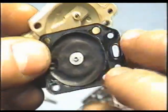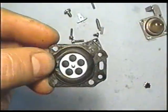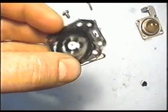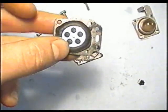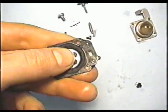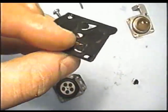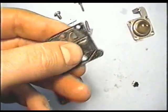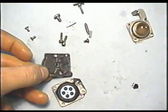You can see there that the gas has varnished a bit. Here's a closer look at the metering diaphragm — when it's in your hands, that's when you really see what kind of shape it's in. This one is very stiff, so that's finished. The pump diaphragm's little valves are also very stiff, so it's not going to work well. We definitely know we need to replace that.